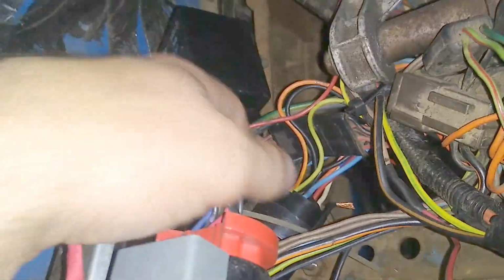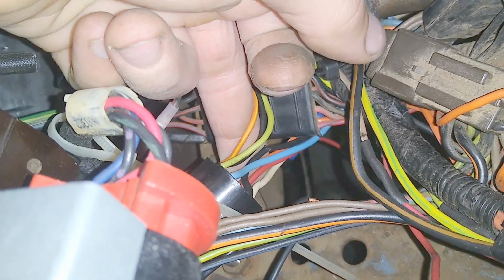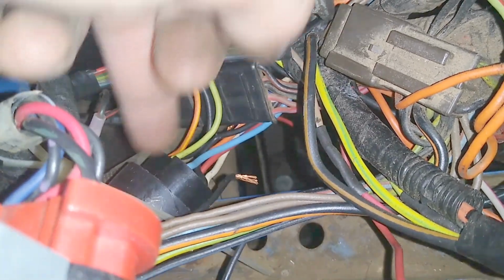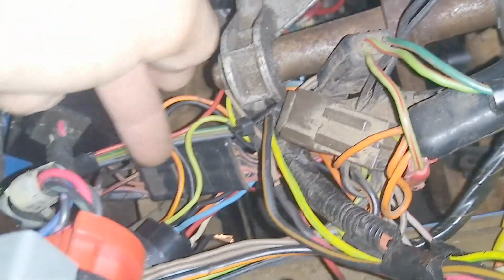So it plugs in though. Let's see here. Down here, this is the wiring to your stock wiper switch. So you just replace the wiper switch with this one. You need this harness with this box, and then it's got the pigtail connector for your stock switch, or your stock wiring to your stock motor. So the wiper motor, I have not changed. It's the same wiper motor, and it works just fine. I haven't had any problems with it.